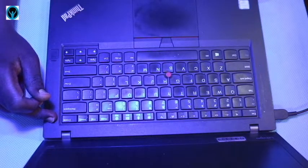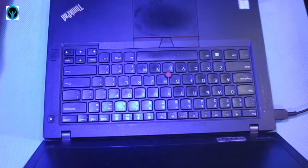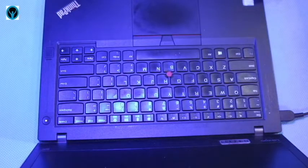Press the power button to try to power it on and you'll get that beeping sound showing that there is no RAM, no CMOS battery, no hard drive, and no battery connected. The error code will represent a memory module error, and the only way to rectify that is by reinstalling or replacing the memory module, or replacing the system board.